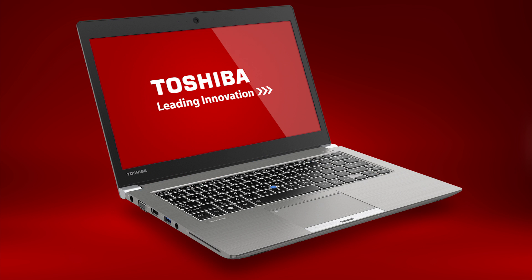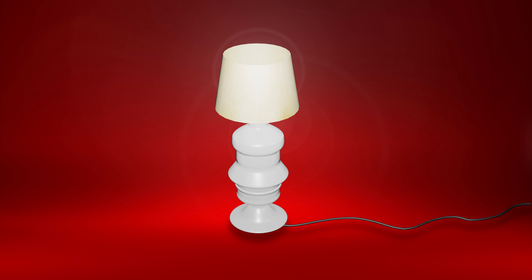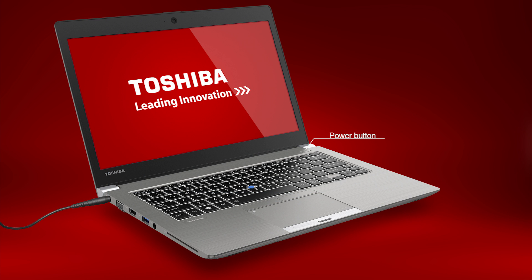Now that we've covered most of the common features, let's discuss some troubleshooting tips. If your unit won't start, here are some things you should do: first, ensure you attach the AC adapter and power cable properly. If you're using the AC adapter, check that the wall outlet is working by plugging in another device such as a lamp. Verify that the computer is receiving power by looking at the AC power light — if the indicator is glowing, the computer is connected to a live external power source. Verify that the computer is on by checking that the on/off LED indicator is glowing white. You can also try turning the computer off and then on. If it still doesn't power on, you'll need additional support.